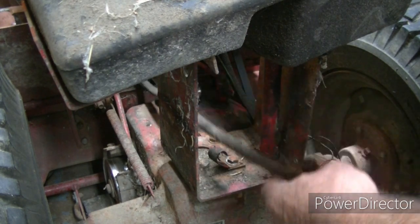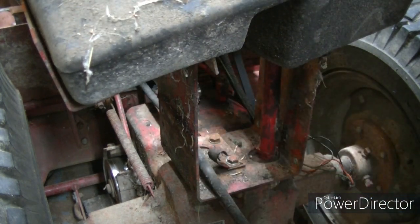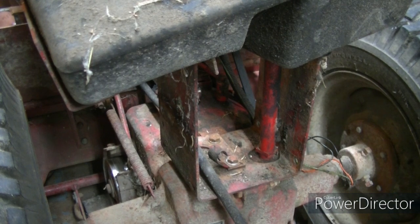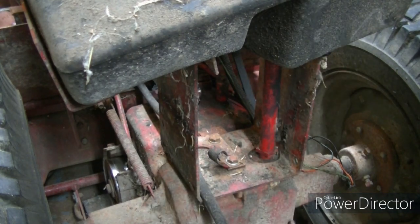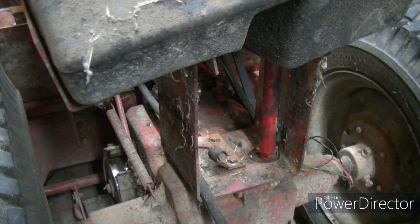Why don't I just put some grease around and go? You won't get it in. Did I rip the grommet? No. Okay. Because the nipple's flared. So when you push the nipple in, it widens the grommet out, holds the grommet in the tank, and also holds the nipple in. Right. Okay. But they don't push in very easy. Is there a pair of pliers right there?